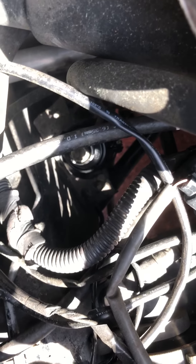I don't know if you'll be able to see this, but we'll see. Bolt goes through — and yep, the camera moved. There's the bolt through the thing. Put your other washer on there, then put it in there. Then just finger tighten it down with your extension. Always finger tighten it down first — you don't want to cross-thread any of these threads. And there you go, it's on there.